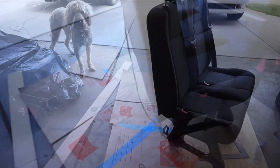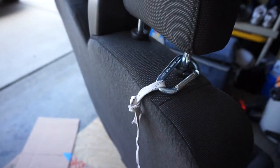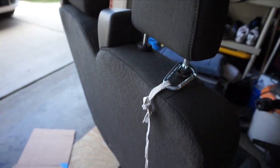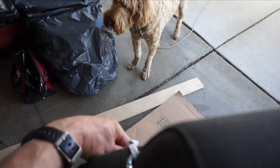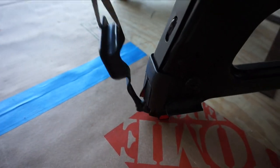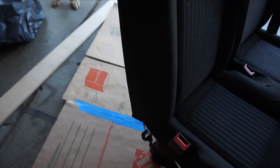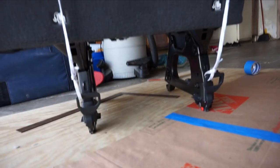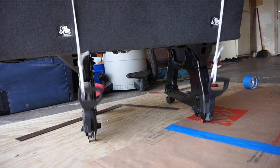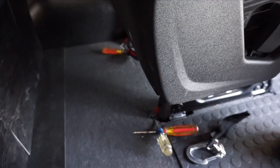Going to repurpose one of my kids' old hockey laces. I tied a string off to that handle, then ran it up and tied it off to the headrest post. That way I don't have to get access to the back — I'll just reach over the top. I'll have one on each handle, give it a pull, and when you pull on that string you're retracting it and the whole seat will just tip forward and give me access. A little more detail than probably needed, but when you reach over the seat and grab the two ropes the whole seat tips forward. That's what we're doing.